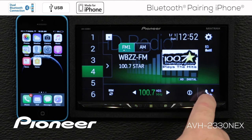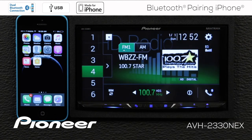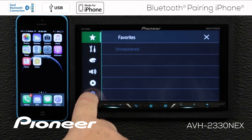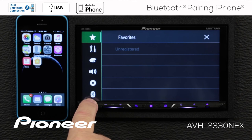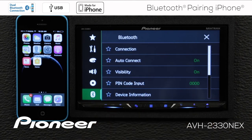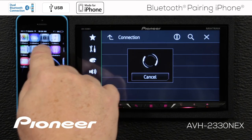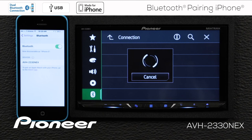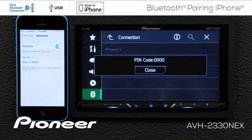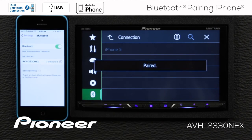The way we do that is we start from the Bluetooth menu and touch the Bluetooth telephone, then touch the gears — but the gears are grayed out, so we need to fix that. We'll hit X, touch the gears, and go down to the Bluetooth menu. Bluetooth is grayed out, so we need to engage the parking brake. Once I engage the parking brake, the Bluetooth settings become available. We'll choose Bluetooth, go to the connection menu, and touch the magnifying glass button to search for devices. Make sure you go to your phone's settings and open the Bluetooth screen — when you open it, the phone becomes visible to other devices. We found the iPhone, so I'll select it on screen. That automatically generates a pairing request: 699731 — the same number on the phone. We say pair on the phone and yes on the in-dash receiver, and the two devices will be paired.